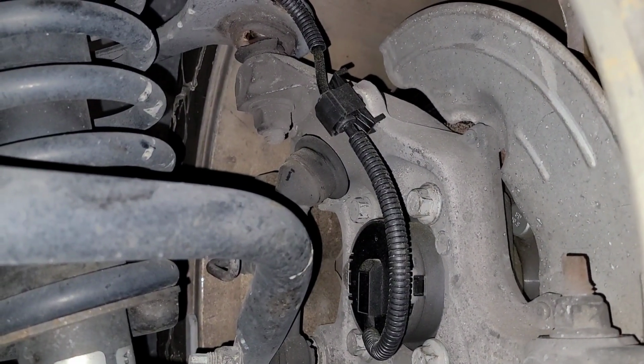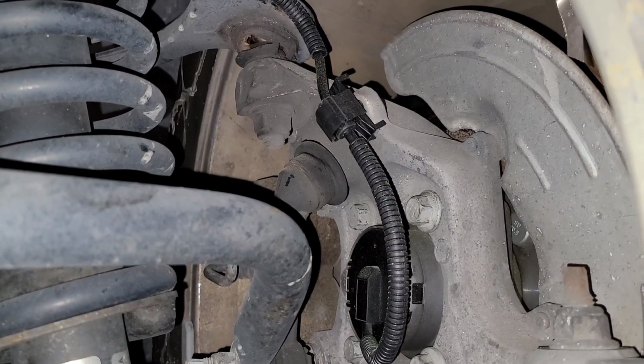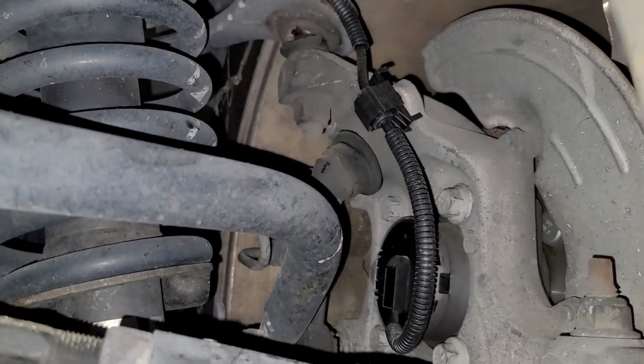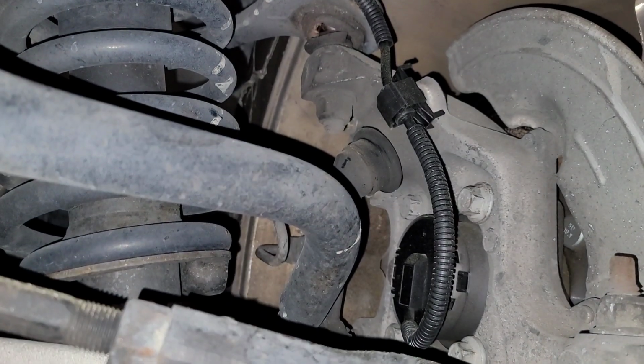Yes, very good possibility you're going to destroy the bolts in the process. But you do one, usually I leave one up and one down on the opposite side, and I try to go crisscross. I'll cut the wheels one way, have them stop, go back, take the tool, move it to the other side, and then do the same thing. And what that does is it'll press the hub out. Works amazingly well. If you've never seen this tool, pick it up.